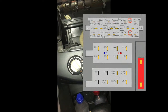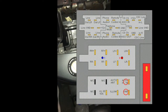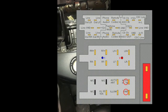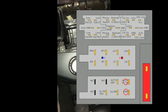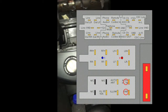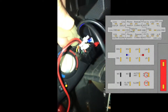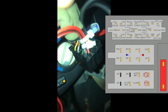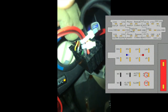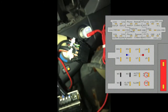So what I did was go back and connect it directly to the battery itself, so the power feeds directly to the amplifier. As you can see on the diagram, I connected the ground and the positive, and then connected the speakers as well.